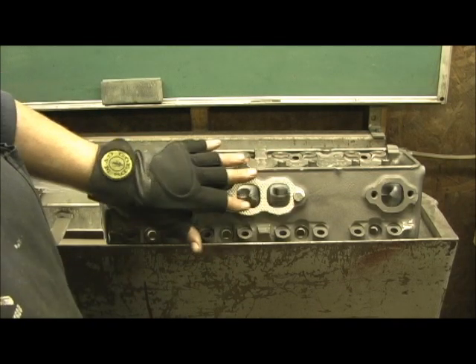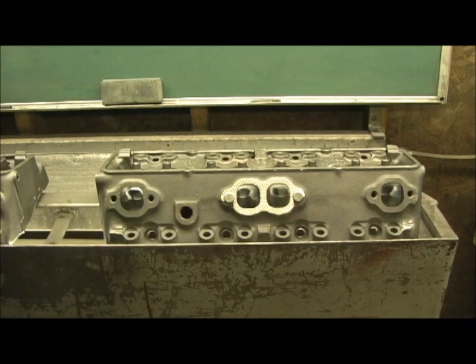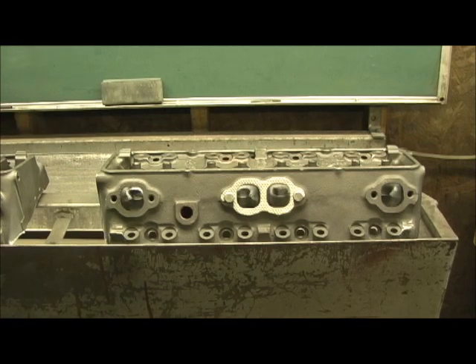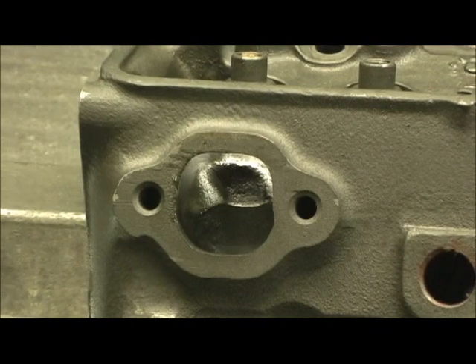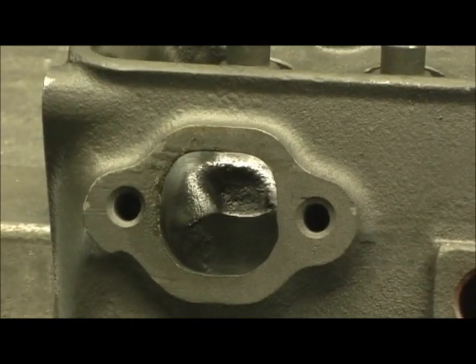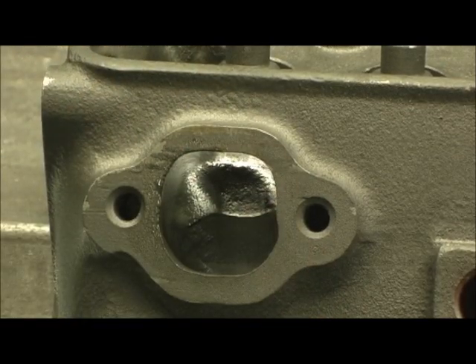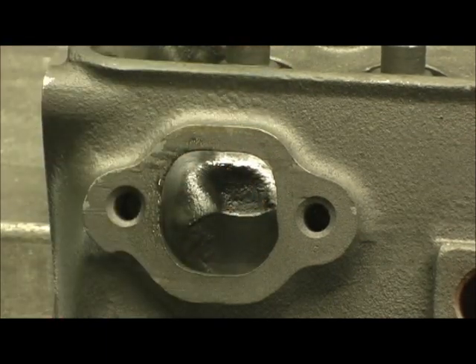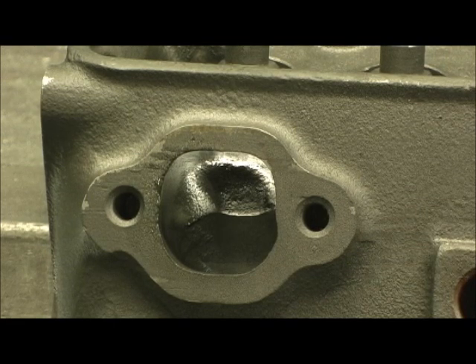These are probably the gaskets he's going to be using since they're meant for an iron manifold. The guy that ported the head got the shape pretty good, but he got a little out of bevel on one of them — he got a little crazy on the bottom. You can see how that wall isn't real straight. I really can't do a lot about it because he's already past the line — you can see how that line would come down and leave a gap.